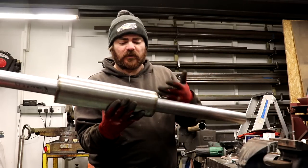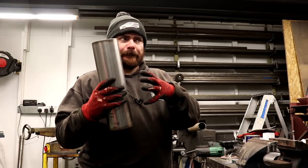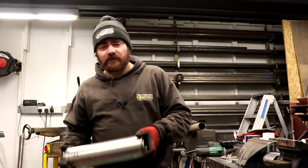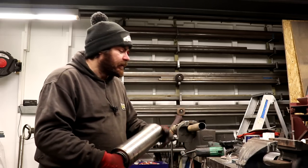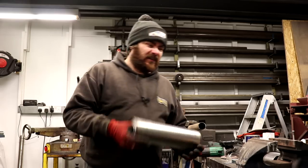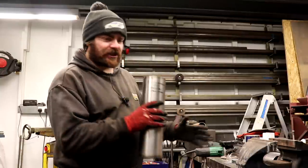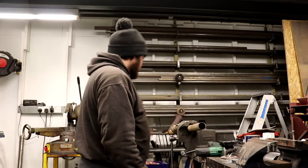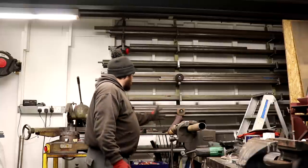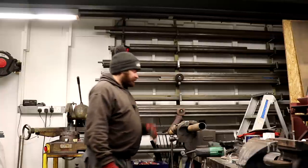That's a stainless box, but the mild one was three pounds less so it wasn't really worth it. I've just gone with mild steel because I didn't want it to look obviously non-standard, especially as it's not having a stainless back box or stainless cross box — they're OEM style. There's no point having a shiny stainless bit and then a mild steel bit which will look rubbish after a few weeks. Hopefully they all age at a similar rate. I might give the hockey stick pipe a lick of silver so it ages at the same rate as the centre box.